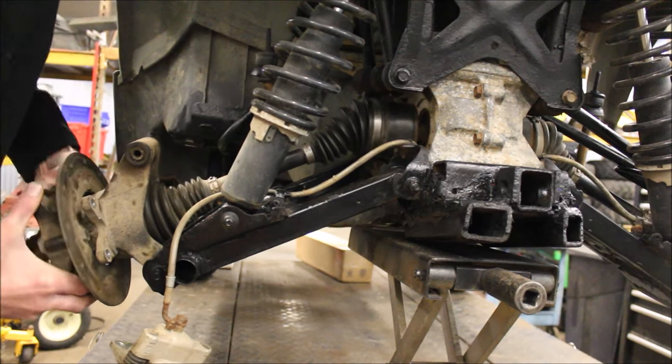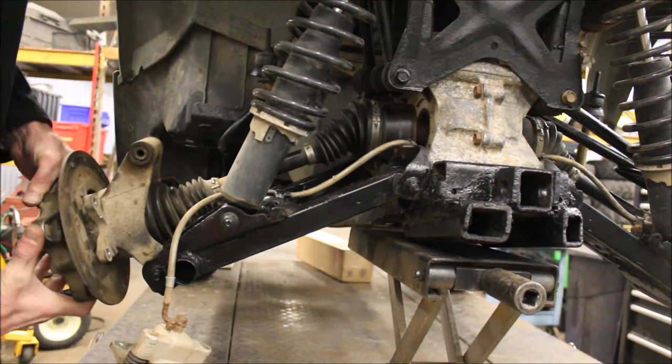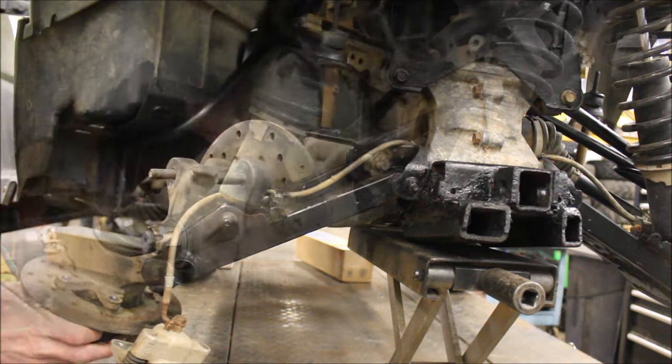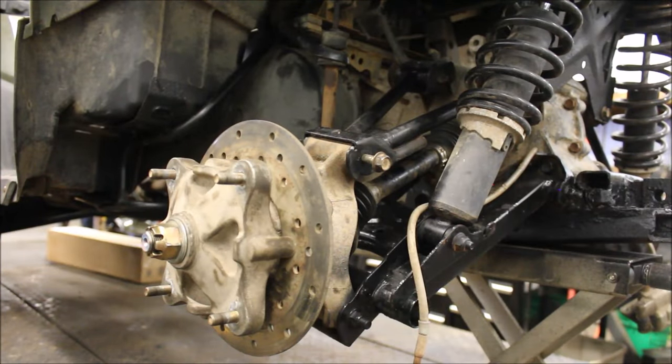Both axles spin. So I got damn lucky. I'll show you the difference between the splines. But yeah, it turned out it was just the axle shaft. A $300 to $1,100 part versus a $69 part. I'd say I got pretty damn lucky.